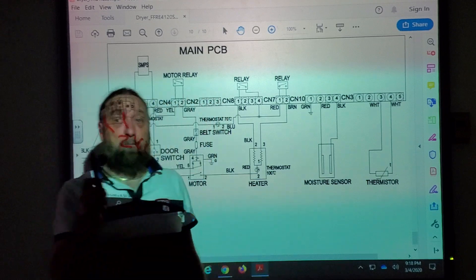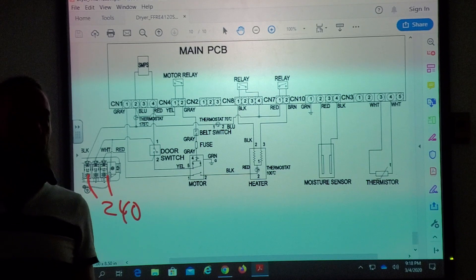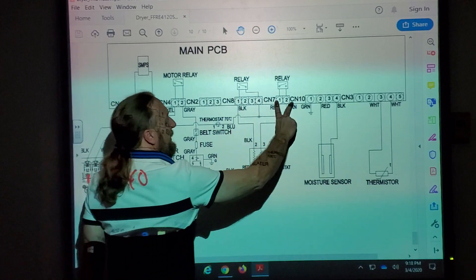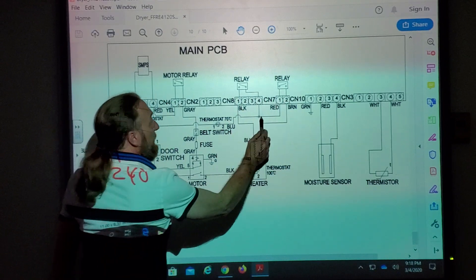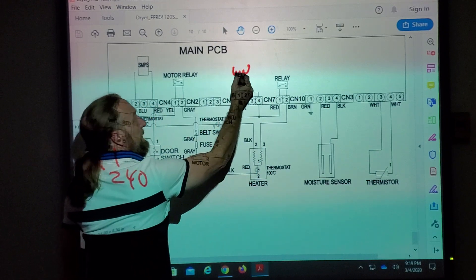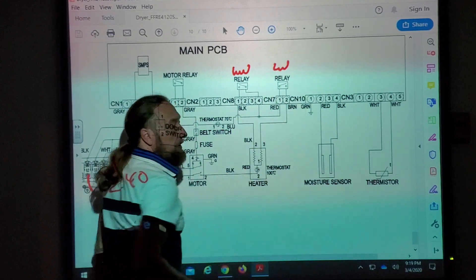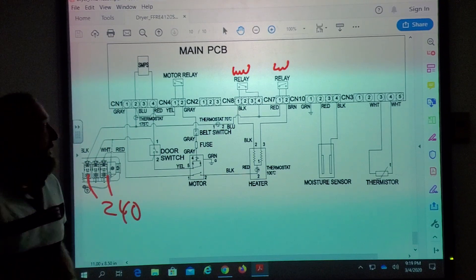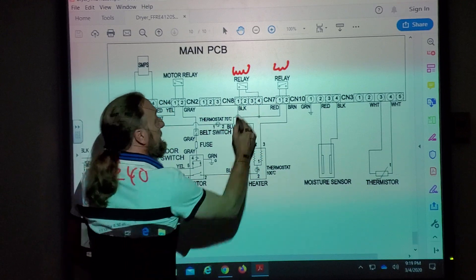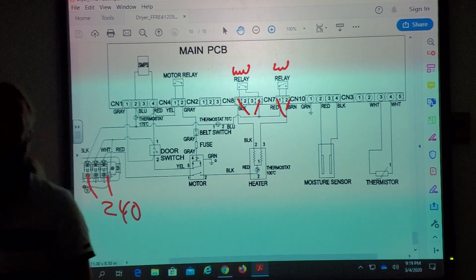Not on all boards can you do this, so be aware. You can do an ohms test on these relays. If we unplug this plug and unplug that plug — this is power going into the relay and power coming out of the relay. There's a coil on the board; when you tell it to start, it energizes and closes that switch. I can take my ohmmeter here and here with those plugs disconnected, start the dryer, and see if both relays are closing.